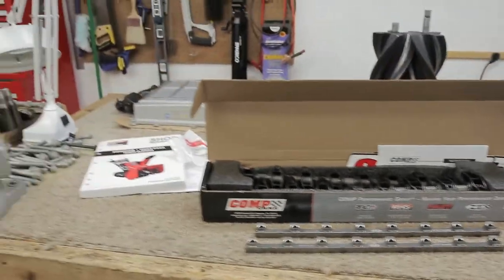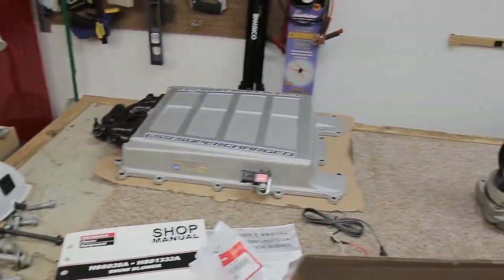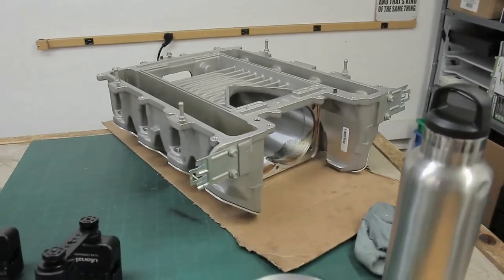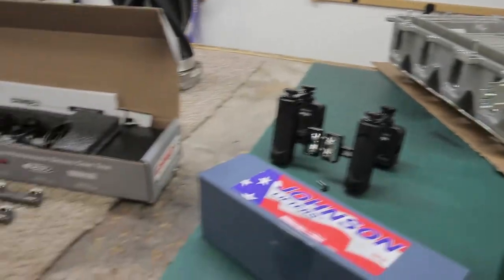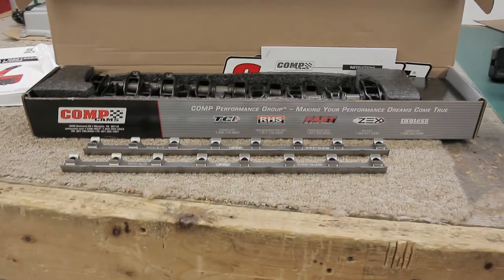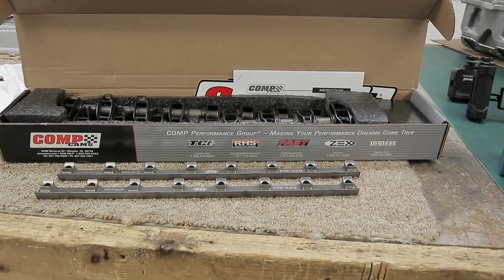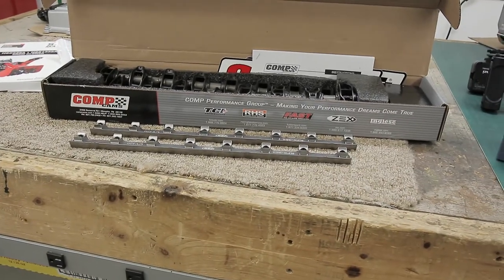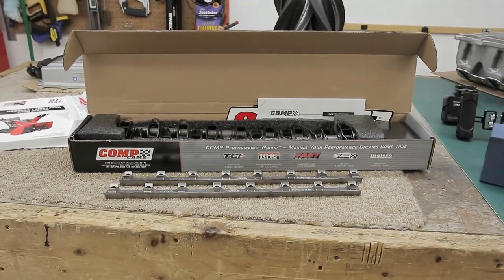As you can see here in the workshop I have all sorts of stuff apart. I have the supercharger off and I will be doing some max effort porting on the stock 2.3 liter supercharger for the LS9. Doing KTEC CNC ported heads, a stage 4 cam from Brian Tooley, a smaller 2.175 Grip Tech pulley, larger injectors, and all the supporting mods to run E85 possibly.